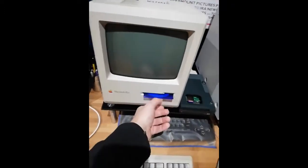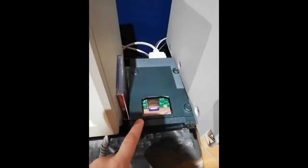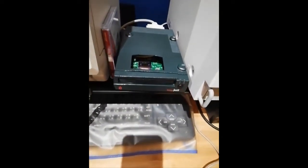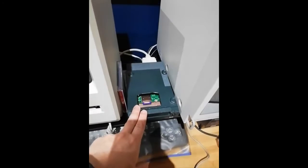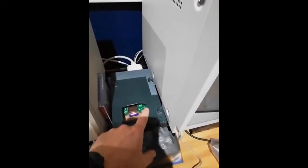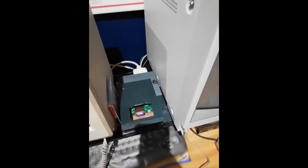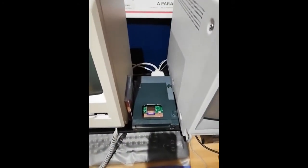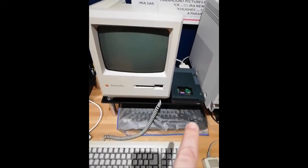As you can see there is a floppy disk here, but I don't need it because this is the SCSI2SD. It's mounted on a Jaz drive enclosure — you can see how I made this on my website with lots of pictures. There's an SD card inside; I removed the transparent window so I can access the internals without disassembling it every time. This is connected only with the SCSI interface — there is no power connection whatsoever. As soon as I turn on the Mac Plus it will draw the energy from it.